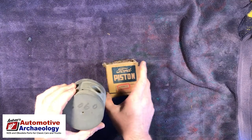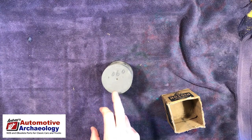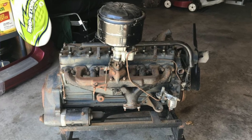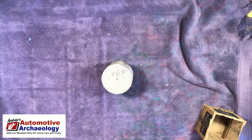This 60 thousandths oversize piston is for the 221 flathead, which they made from 1932 to 1941. It was replaced in 1941 by the 226 cubic inch flathead six, also known as the G series or G engine — the precursor to the straight sixes everybody knows from the sixties. Whenever I get G engine parts I basically throw them away, because nobody builds G engines. Can't give them away. It was also the same 90 horsepower.